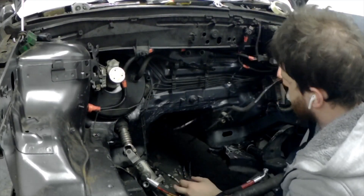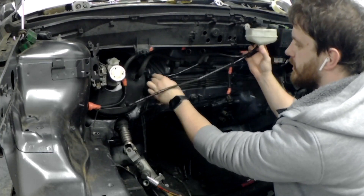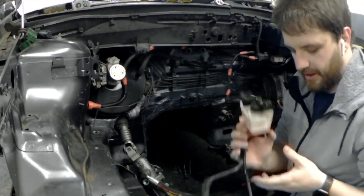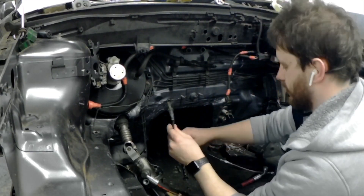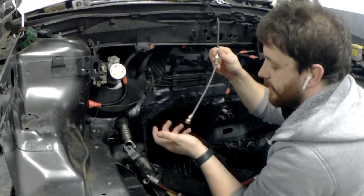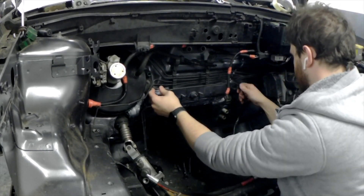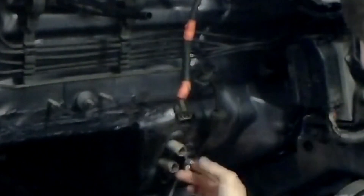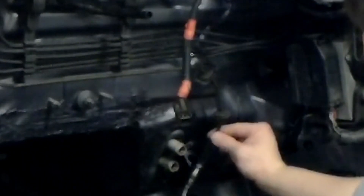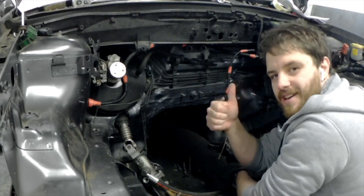While I'm here, I'll show you the clutch lines. This sits there somewhere and plugs into the clutch to give it fluid, and also plugs into the brakes. Then from the clutch we have a hydraulic line — I've had one made up to fit, I think it's UNF, and a banjo bolt which is on the slave cylinder on the gearbox. I messed up a bit — if we put this in here, that fits almost perfect there. But because I had trouble flaring this pipe, I've put this mount in the wrong place. I need to get it properly flared by someone with a better machine than mine. Then that rubber mount can be held there, that goes onto the gearbox, and we'll have a clutch line.